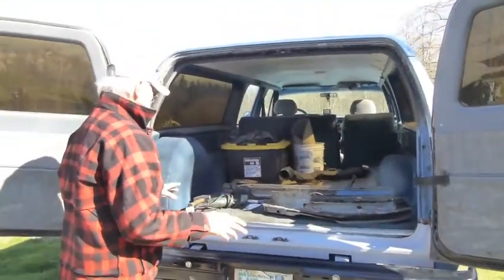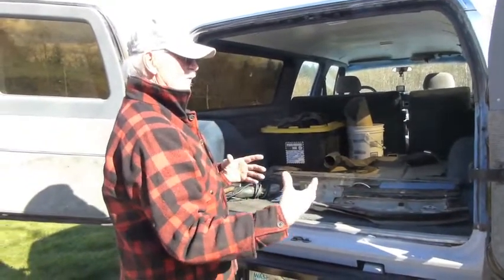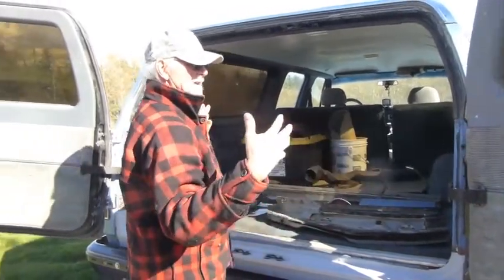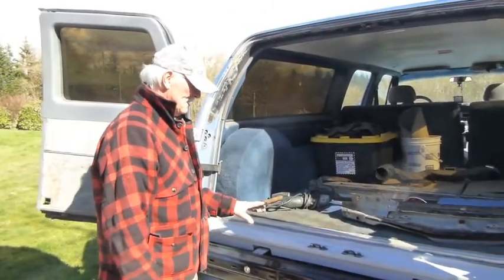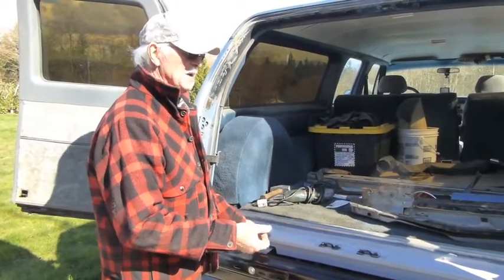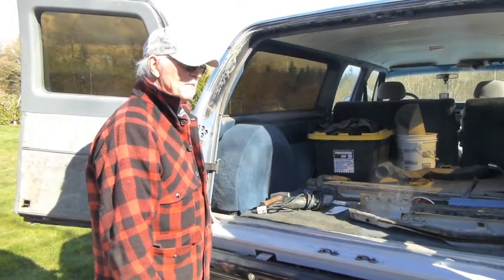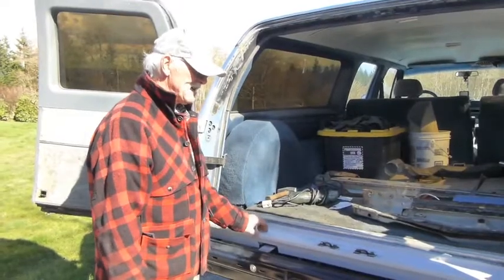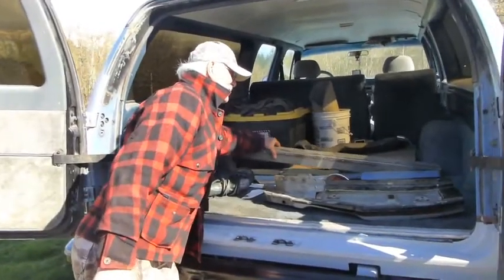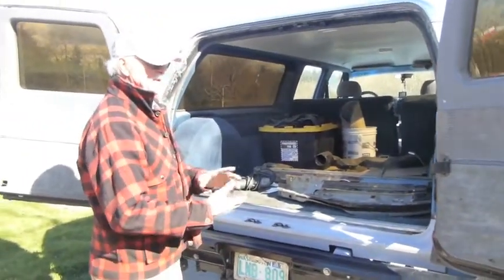I hope this helps a little bit. It's a doable thing — just going through the tail light to do the bottom ones. I did that before I did anything else. I didn't even take the tailgate off — I put these hinge plates on first so that I knew I could do it. The hardest thing would be getting this piece off whole and trying to use it with the other one, but otherwise you could buy a whole new piece for at least $200 from that catalog plus shipping. So if you can salvage this, it's better off — just use a cutoff wheel and cut the whole thing out.